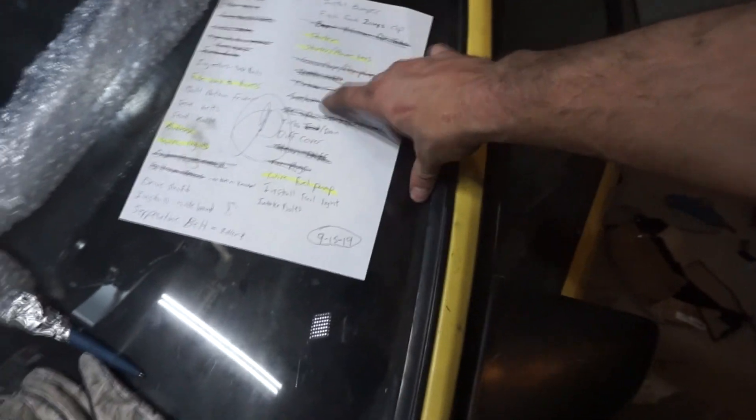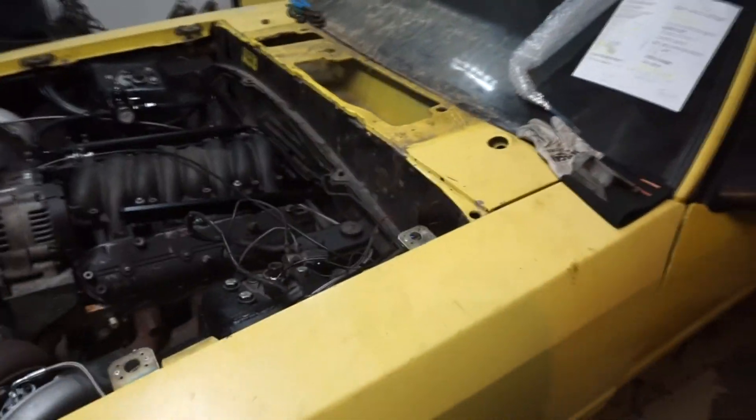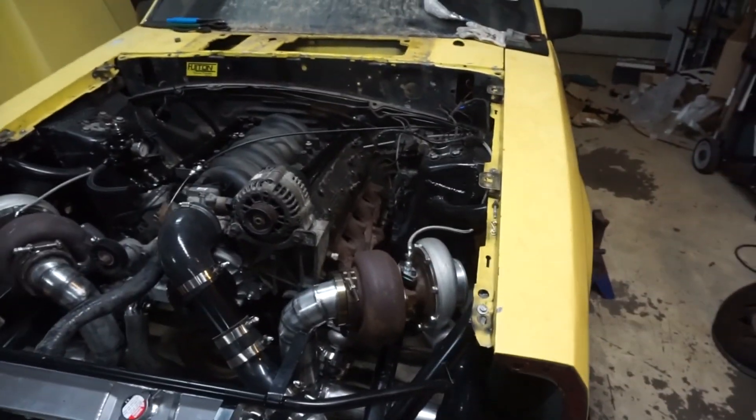Also cleaned out the diff. One of the things on the list was cleaning out the differential - for some reason the differential in the back didn't have the cover on it, but all the holes were completely plugged with dirt. It was like somebody took dirt and packed all the bolt holes full of it. I had to take a little drill bit in there, clean all the dirt out, then slice some slits in a bolt and ream out the holes. It took probably an hour just to clean the mud out of the bolt holes, then I cleaned out all the leaves and junk. It's clean and ready to go - just need to put the cover on and get some bolts for it.